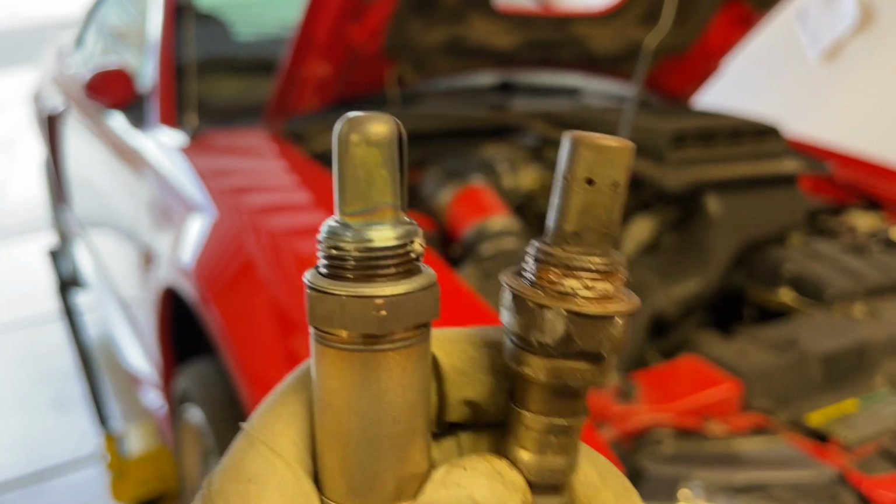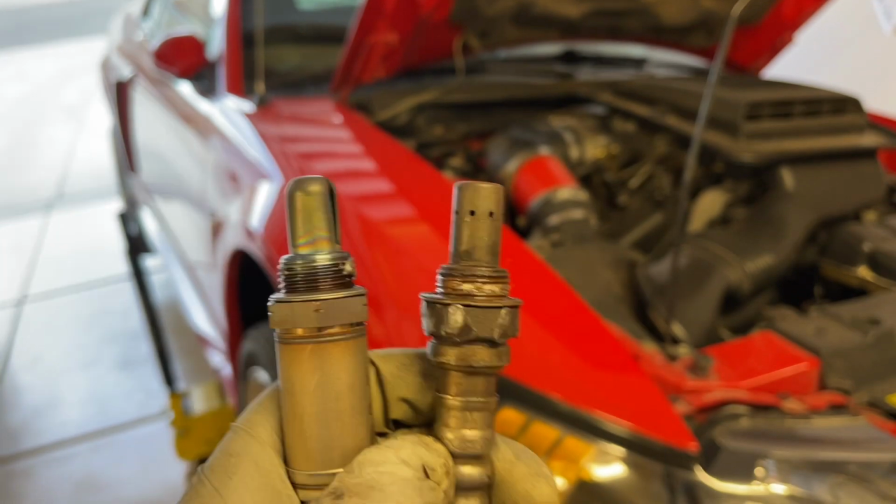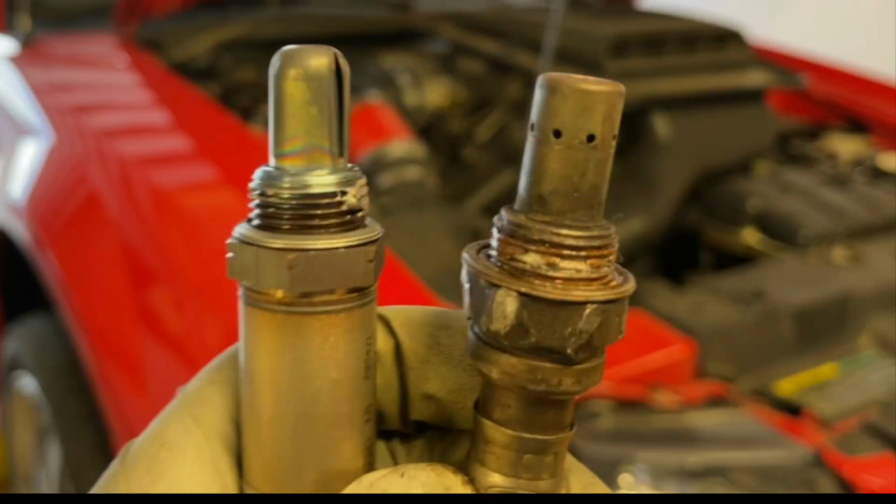The next big thing is the nose. You can definitely see the slotted holes versus the slit, a completely different design. The base is also much thicker at the bottom, but other than that, it's the same 7/8 inch size for the wrench. It's probably just a newer sensor that they've been using on newer cars, and now they're just adapting it for everybody.